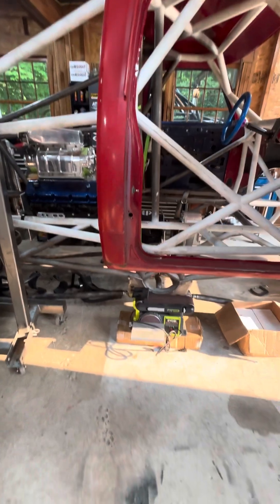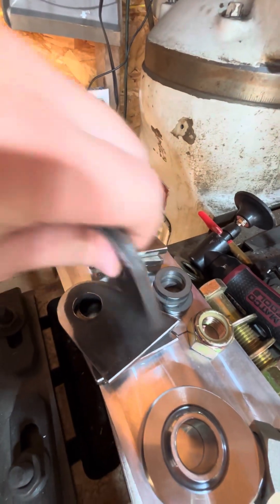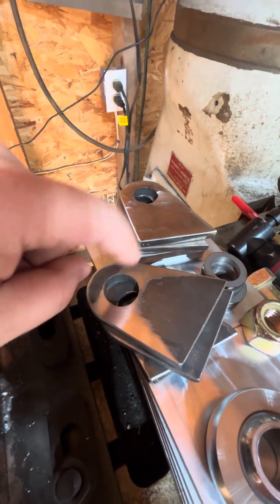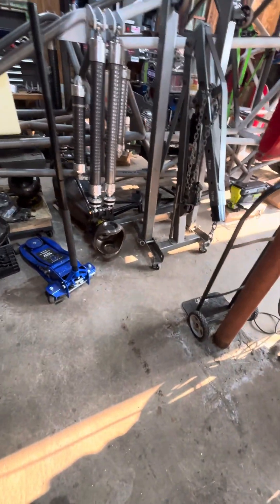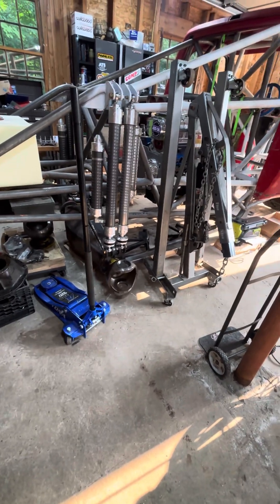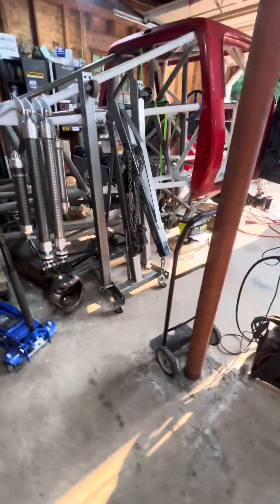The four-link bars on the bottom still need work. I took the existing mounts and needed to angle them forward, so I cut them, cleaned them up, and ordered a drill bit to open the holes up a little bit. Then we're gonna start measuring so I can cut some tube and get the four-link at least tacked in place for the uppers. We'll finish-weld the axle later — still got a lot more to do on those.